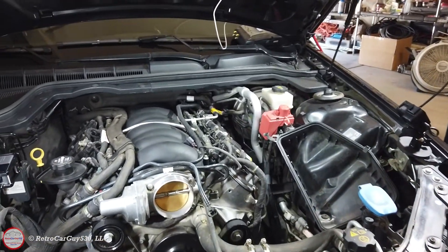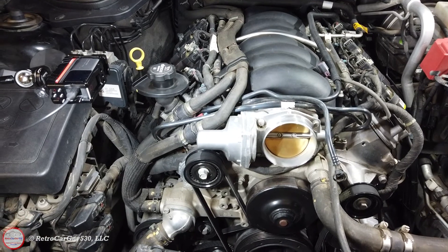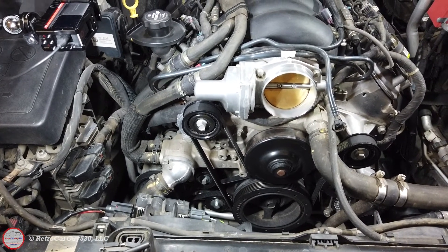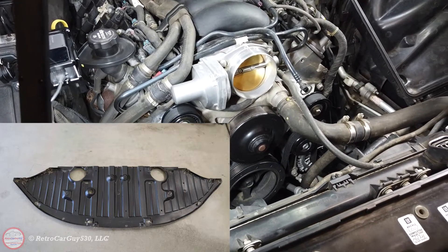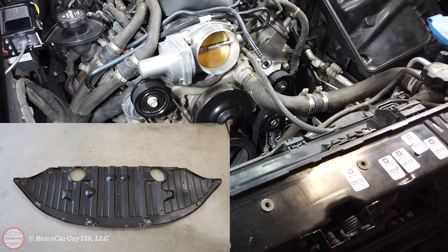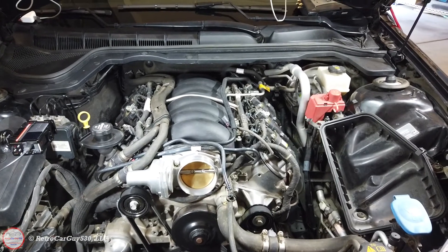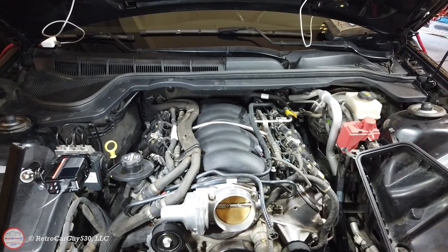And of course the car. I've already taken the air intake plastic pieces out of the way to give a little more visibility. I'll be taking off the drive belts to get those out of the way and protect them from the coolant — I have to take off the main one anyway for the water pump, and also the air conditioner belt. I'll be putting plastic underneath the water pump to capture most of the coolant into a pan underneath. The front bumper fascia extension removal I won't show in this video, but I'll put a link in the description to another video covering that. Hopefully this shows you a pretty much all-inclusive set of steps for refreshing all the hoses — use it for your entertainment purposes and let's get to it.